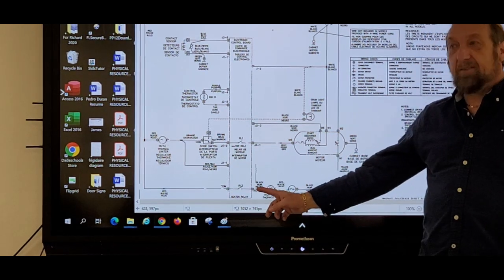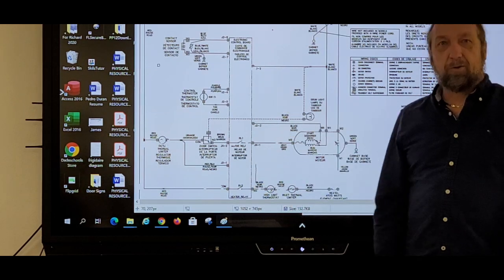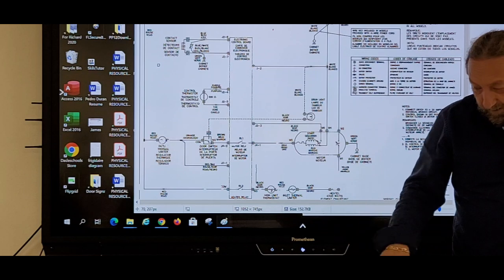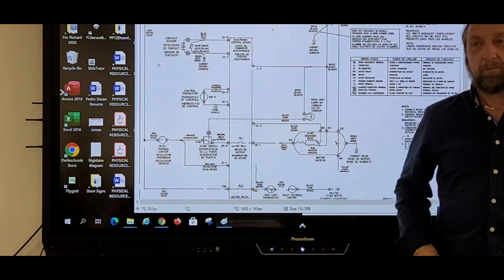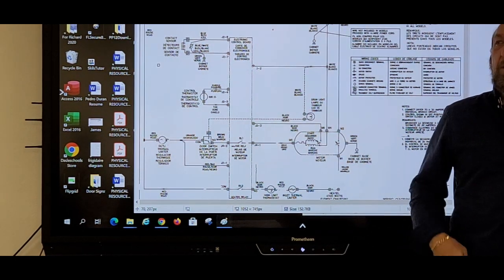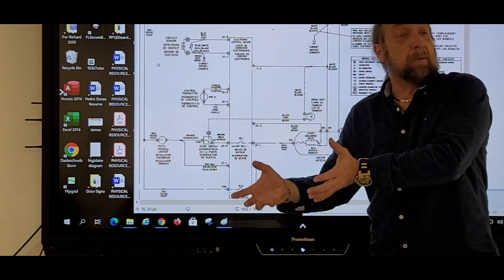So when you find a place on the board, like let's say the pump is the heater, I would put my voltmeter here, my voltmeter on neutral, and then say, okay, energize it. Okay, there's nothing but the pump connected to the board there, so that's all. If I got power there, my pump's bad. That's where these schematics come in at. And then you have to figure out ways, how can I use this schematic?